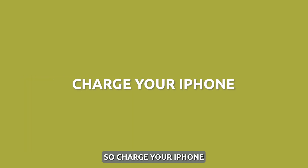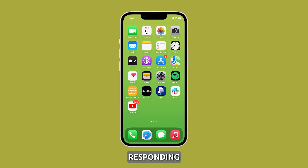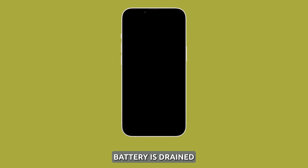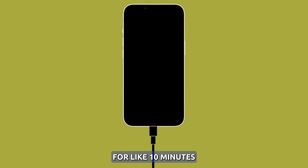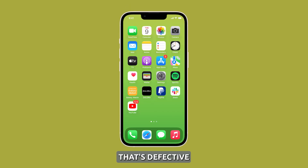So, charge your iPhone. As long as your device doesn't show any signs of physical or liquid damage, the reason why it's not responding is because its battery is drained. So, connect it to a charger, and then leave it for like 10 minutes, regardless whether it shows the charging symbol or not. Most of the time, it will power up after a few seconds of being connected to the charger. If it doesn't, then try doing the forced restart while it is connected to the charger, and that should do it. But then, of course, there are rare occasions where you get a unit that's defective out of the box. So, if your iPhone 14 isn't turning on no matter what you do, bring it back to the Apple Store and have it checked, or even replaced.